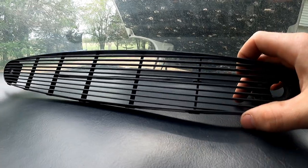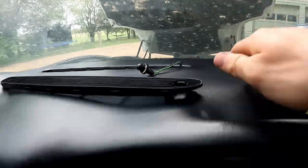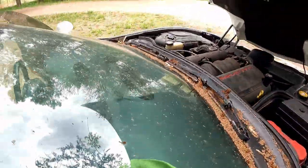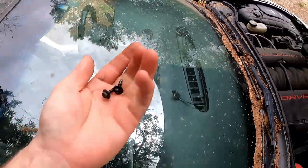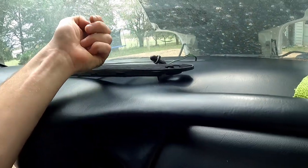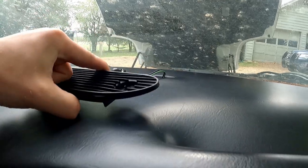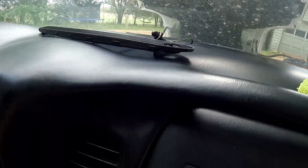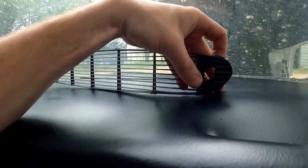I've dusted off the vent up here and pulled it out. We have two bolts — both seven millimeter. I'll show you on the outside of the car because it's a little easier to see: one goes right there and one over on that side. I'm going to go ahead and get those screwed in, then we'll put this inside, twist it, and snap it back in place.